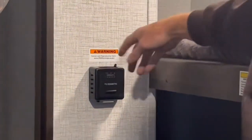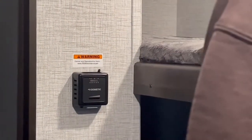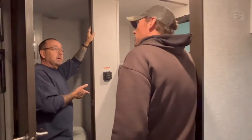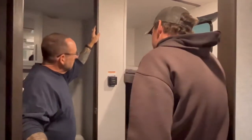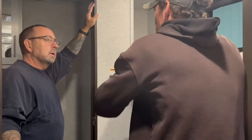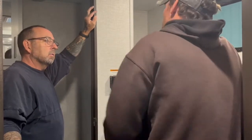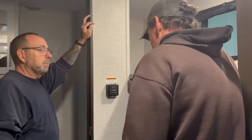If you push it towards you, it turns the furnace on and gets your pilot. It'll light, and then you have your temperature underneath there. Since it's going to light and have a pilot, you need to be hooked up to power first — you cannot run your furnace off your battery alone. You have to be hooked up to shore power. If you're running off battery, you'll eat that thing dead fast. The heat's coming from the propane, but it's got a 12-volt system and you also need 110 too. If you had an inverter, you could pull 12-volt and convert it. So for winter camping, you probably need a generator plugged in.